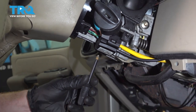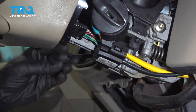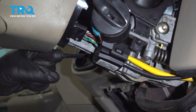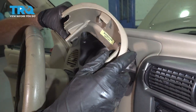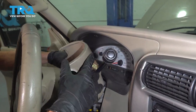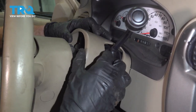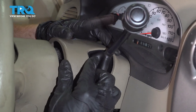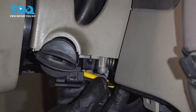Perfect. Now we're going to take the tilt rod and start it in there a few good threads — we don't need to tighten it yet because we will be re-removing it. Once it's in there, give it a tug and tilt your steering wheel down. Let's put on the upper clamshell. Make sure we line up this area here — it should want to slide right down.